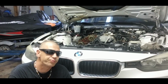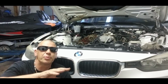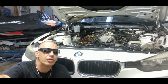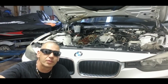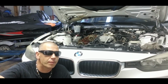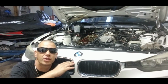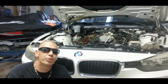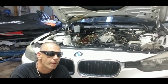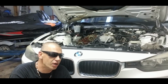Right now we know the 1, 3, and 4 cylinder compression is okay. The number 2 cylinder compression is not fine. I pressure tested the coolant system, and the coolant system is leaking right now. My plan is, tomorrow I will put back the valve cover, injectors, spark plugs, put in some fresh cheap oil, and warm up the car the right way and see what's going on, because